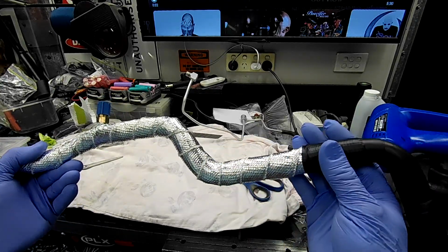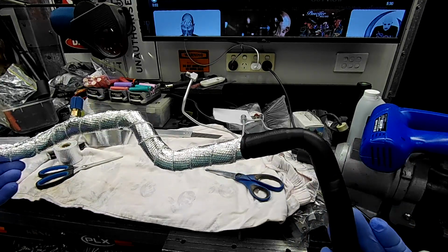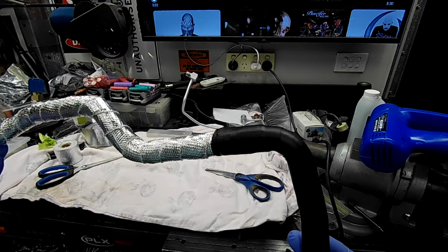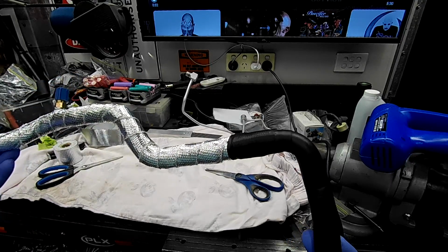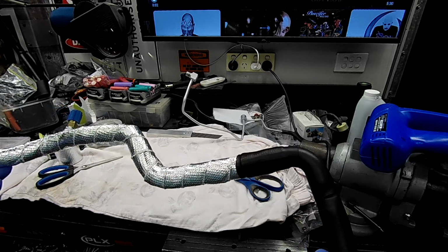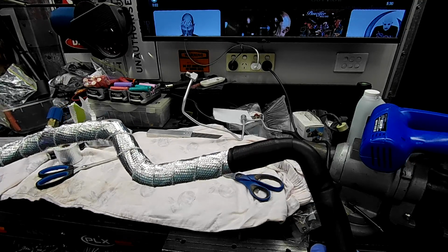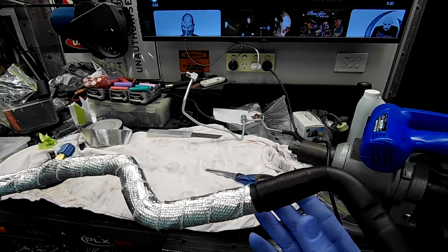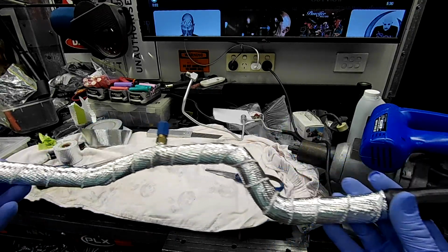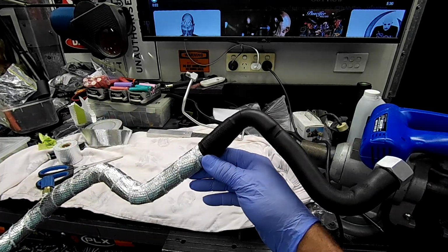Once it's out of the main zone where it's going to get hot, a bit of heat shrink will contain it, and you will never, ever have to deal with it again. You can obviously put a cable tie or a bit of lock wire around there, but it always looks like crap, and you end up with sharp bits where you've cut the wire off where you've finished it off, mate. Bit of heat shrink. Easy as. Anyway, that's that one. I guess I will move on to the next one now.